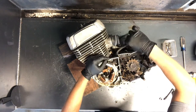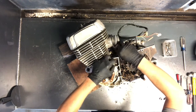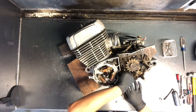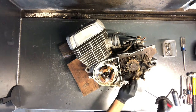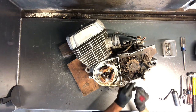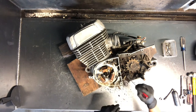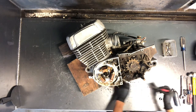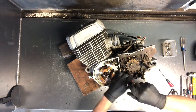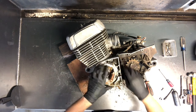That's out. We've got our stator wires running out here and our pulser wires — here's our pulser. These just push through here. It looks like we've got a sensor here that's going to be holding us up as well. I'm going to clean some of this dirt out so we can find this sensor wire. We've got a small Phillips here. I'll loosen this up slightly and that will just pull right out of there. So that sensor's ready to go.